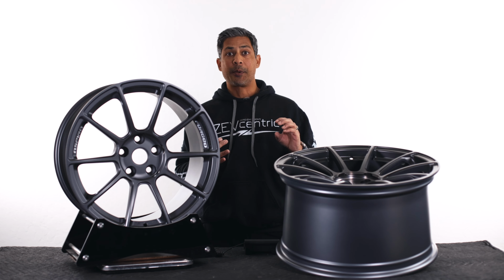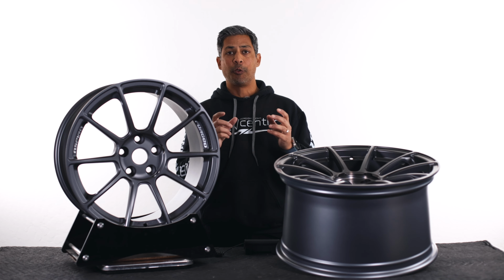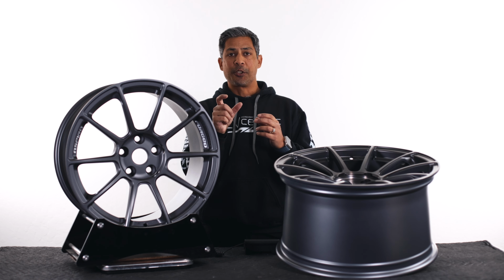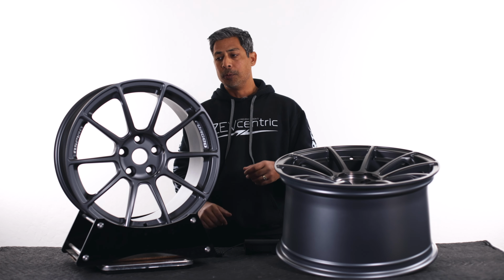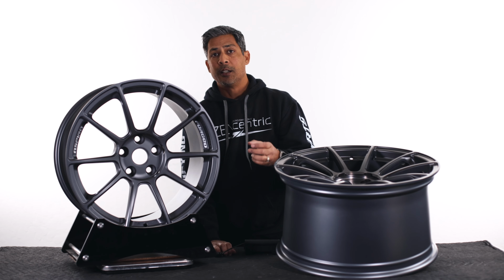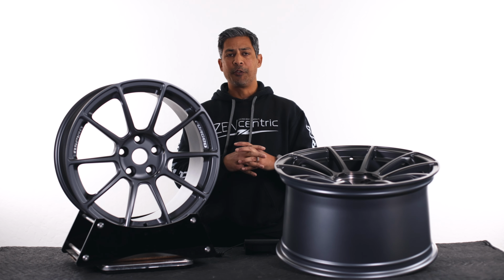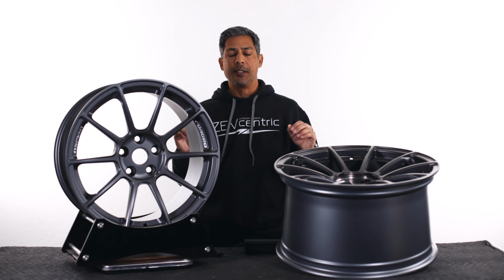They will also accept H&R spacers, which have a shank. So the 10 millimeter or the 14 millimeter spacers from H&R use a shanked lug nut. So we've made the hole for the lug nut here, the stud, just like the factory wheel, so that shank will fit in there. So we've kind of checked all the boxes.